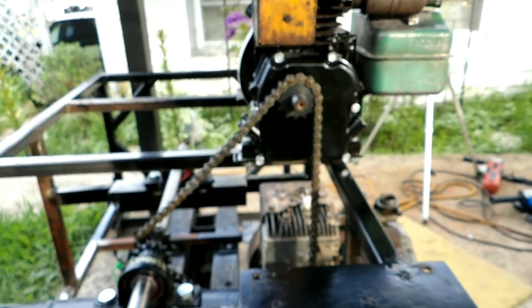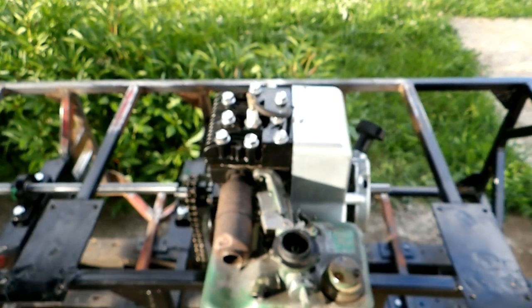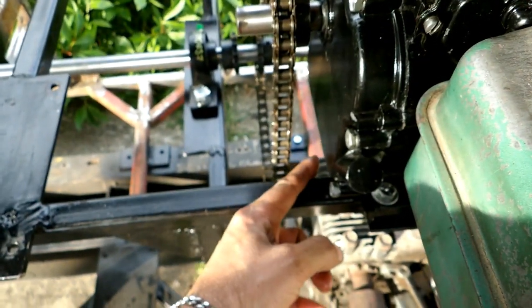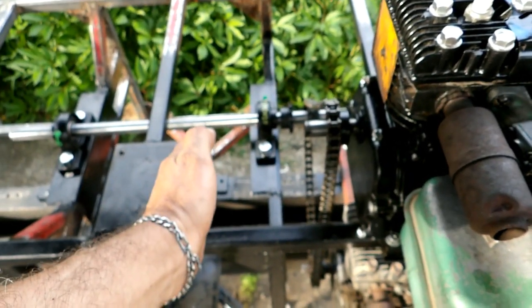From watching it when it was running, I think I'm getting some frame flex too - just from the way it was acting. It was almost like the motors were rocking a bit, twisting that cross member. So maybe I'll be adding some more gussets underneath them, kind of like I did on this one. I can't go too extreme though because the chain is right there - I've got all kinds of limitations with the chain drive. At least I know my length calculation is right though - I had the bottom engine sitting back here and was able to install a starter cover without running into the shaft on the other one. So at least the spacing is correct.